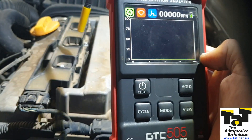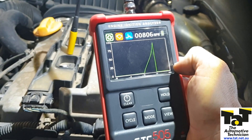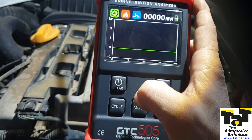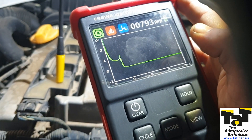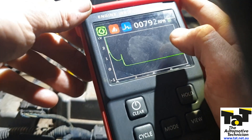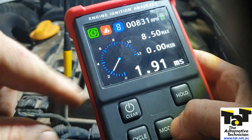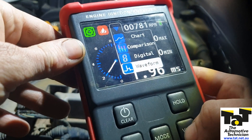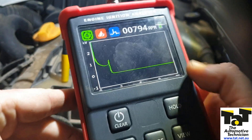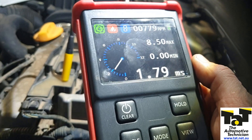We know we're getting a trigger, power and ground, and we've quickly ruled out things like a poor ground at the ECU for the transistor — it's ruled out because we're making the amperage. Now we'll go to the last one I usually use, being burn time. We can look at the waveform or go to digital, and it's giving us our burn time in milliseconds. You don't need to know anything about reading a scope to read a number and ask are they all similar? Number four, we've got a burn time of about 1.8 milliseconds.